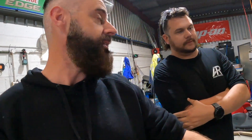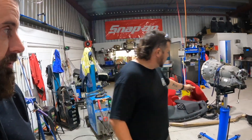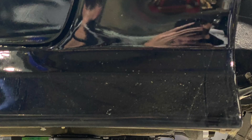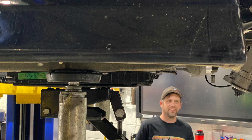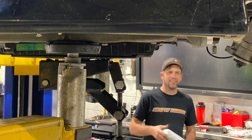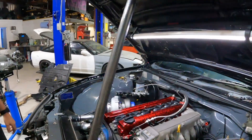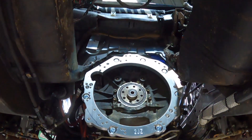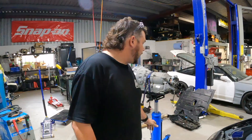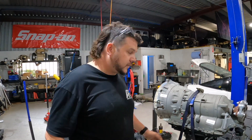So how did that come about? Because when I left here yesterday, you said you were just going to bring it forwards and maybe get like 10 mil. Yeah, then I did do that. I came forward a little bit and came up 10. I still had the pan about 20 mil under the rails. And because it's so low, I don't want to run it with any exposure of the pan to the ground, speed bumps, or ripple strips or anything. They're plastic and expensive. You just don't want to be stuck — you want to keep being able to drift. This should give me about 8 mil of the pan above the chassis rails, and then I'll put an aluminium bash plate underneath the whole thing as well, so that'll protect it even more.